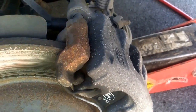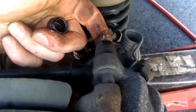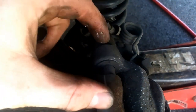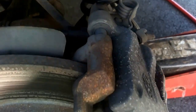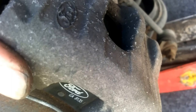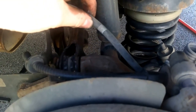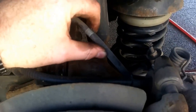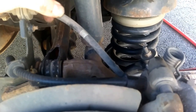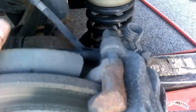The way these are designed is pretty simple. There are slide pins with a press cap on them that you can pull off with your fingers — it's just a dust cover. You use your Allen wrench down inside the hole because the slide is threaded with an Allen top — it's a 7-millimeter Allen. You unbolt the top one and the one on the bottom, and this whole shoe will rock off. Be careful not to tug on any of the brake lines, because the older these get, the more brittle they are.